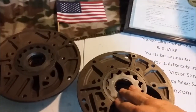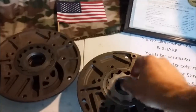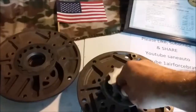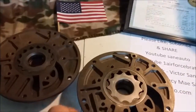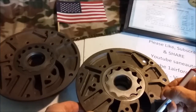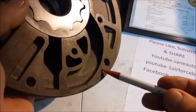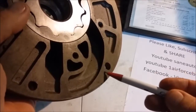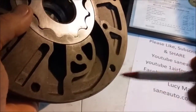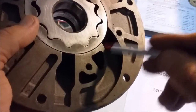Then from 90 to 2004 you'll get the 0.750 gears. Right here this will be carved out all the way to this bolt hole here — a wider opening. It will be carved all the way out so you have a wider opening for more fluid to flow in here. And this might be a little bit wider too.